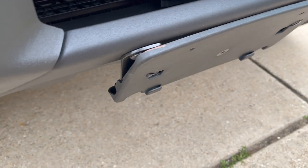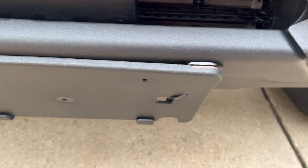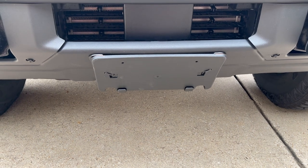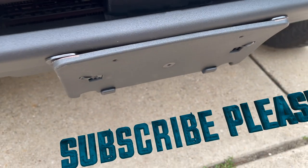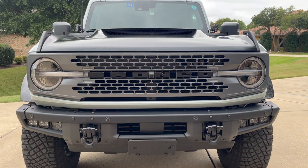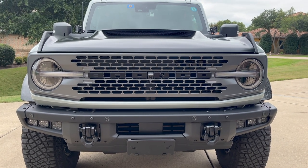Well YouTube, that's what that looks like fully installed. Pretty simple — run to Home Depot, pick up some one-eighth by one-and-a-half aluminum, and it's a 20-30 minute project in the shop to have a front license plate holder. I'd say that thing is plenty secure, adjustable for any angle you need. I think it's still plenty legal for a front license plate in Texas even though it's sloped back a little bit. Appreciate you watching — if you haven't hit that subscribe button yet, now's a great time; doesn't cost you anything to subscribe. We'll have some more mod videos coming out for Pebbles in the future. Till next time, hope y'all are keeping it bad to the stone — we'll be here in the shop working on more mods.